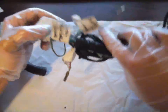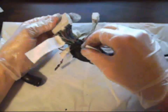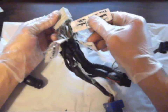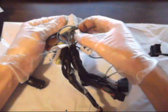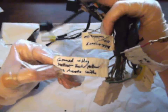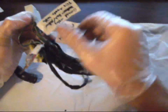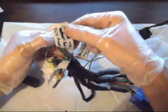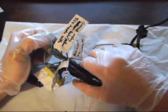Fourth, label this black wire right here. If we were looking at it with the green and white stripe wire at the top right, it would be on the bottom row, third wire in — it's black. Label that ground. Using the red-yellow wire it meets with basically means that whenever you plug this in, the wire that this connects to will be red with a yellow stripe, and that needs to be run to a ground. And that's basically all there is to the preparation of the actual harness.